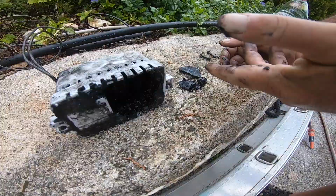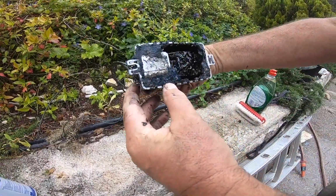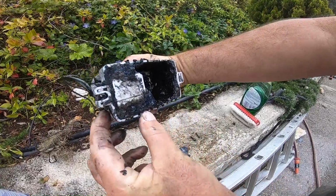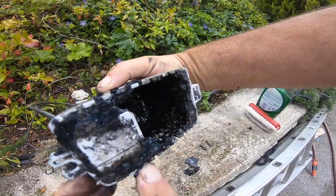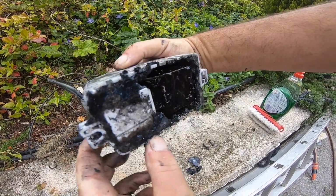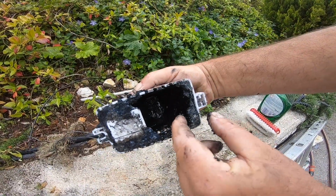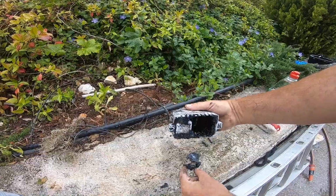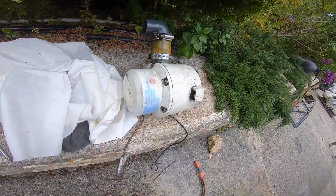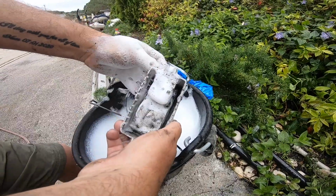So this crusty crud was inside of the float switch. If you look inside the float switch, it's sticking on all the crap somewhere. So it basically has gone into the on position, and then it can't get back down to the off position. See this stuff here? So all of this lot here is just preventing it from doing what it's supposed to do. So nothing wrong with that. So that's clean enough to go back in. Cleaning it up with soapy water, bit of paint thinners. That float switch is working now, right? Yeah.